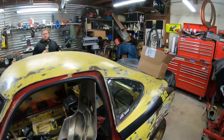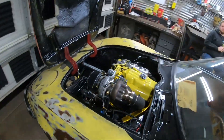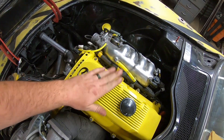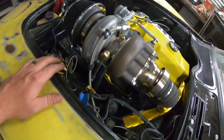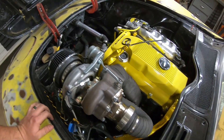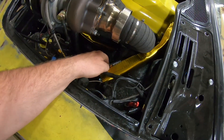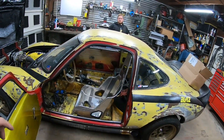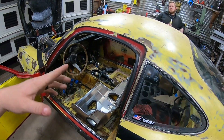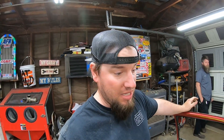That's it for Wednesday night — got a little bit more progress done. Seat is mounted; you can shake the whole damn car with it. Throttle pedal is done and tested. Throttle cable is completely installed — this is the factory Miata cable, fresh from Mazda. We might go a different route and get something a little longer so we can reroute it better, because right now it's pretty close to the turbo and all the downpiping so it's going to get hot. Shout out to Mishimoto for getting us those little heat wraps — got a couple more we're going to use. Moving forward into tomorrow and Friday: passenger seat mounted, button up some of the wiring, do a once-over through the rest of the car, and install the driveshaft — it's supposed to be here tomorrow. If we can do that, we can test it and get ready for Saturday.